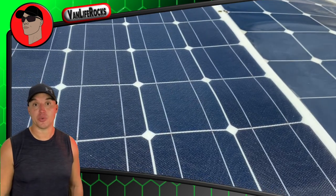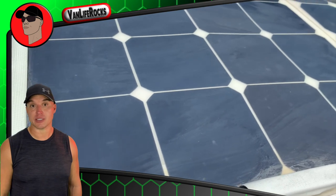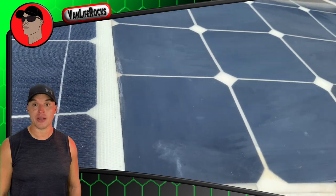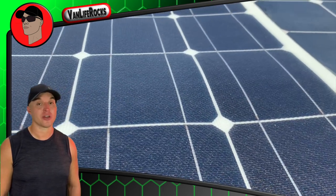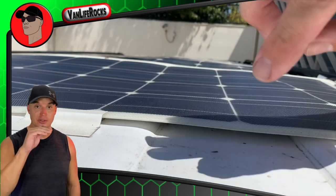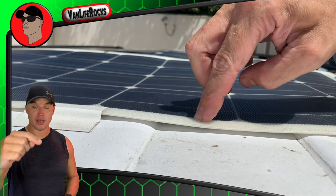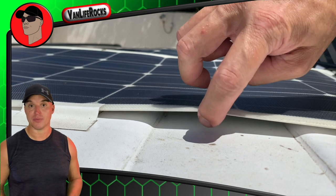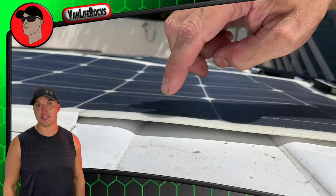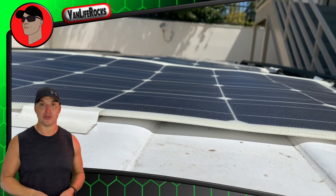Some people have an issue with flexible solar panels — they tend to overheat, which causes wear and affects the longevity of the panels if they're directly touching the vehicle. On hot days heat transfers from the vehicle onto the solar panels, affecting efficiency and causing wear that makes them only last about four years. On my van there are channels and ribs, so I've placed the velcro on the ribs so the solar panels do not touch the vehicle. This allows airflow underneath the panels and, more importantly, allows water to drain from underneath. Water can go right through those channels, so there's no rust issue and the panels can cool off while you're driving.